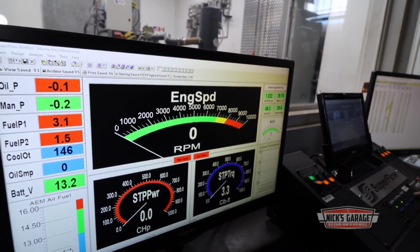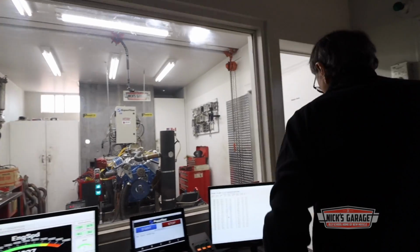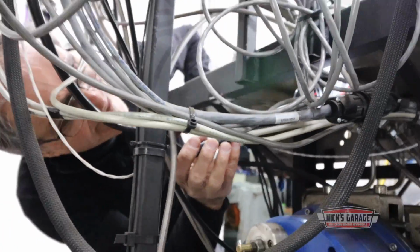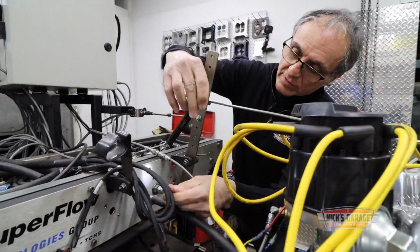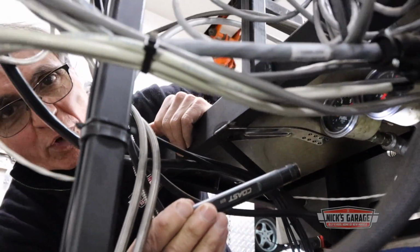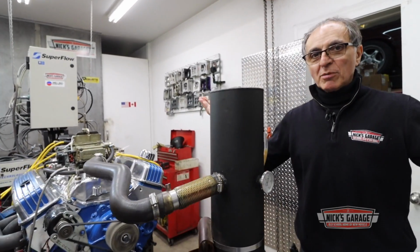By the way, I could go and check over there behind the car, behind the engine. Here we go. It's good. See? Fuel 1, and then you go underneath here. I've got 7 pounds of pressure, so the pressure is good for the fuel line. I've got enough fuel pressure to feed the carburetor. So the problem is internally.